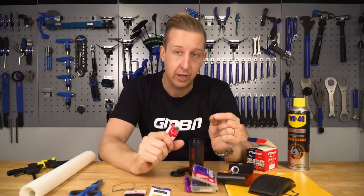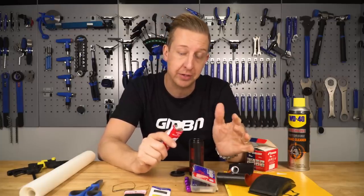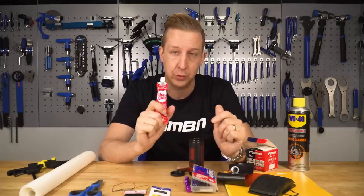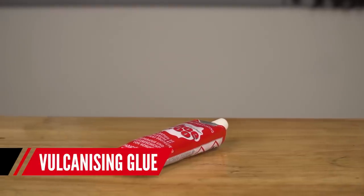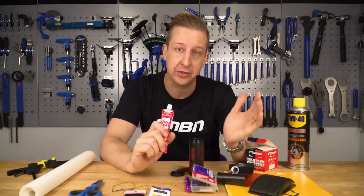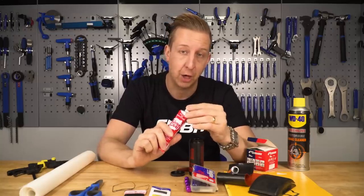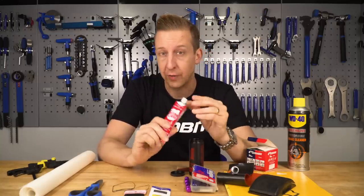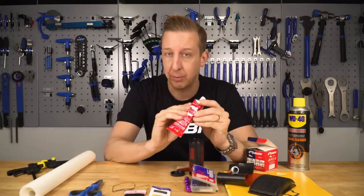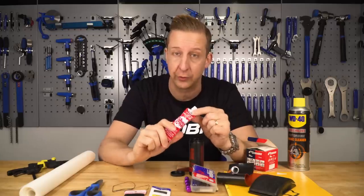The last thing you're going to need is something to finish the job on the outside. The idea is to stitch up the hole, patch it on the inside, but because the stitches are still exposed on the outside you want to give them some protection. This stuff is called Shoe Goo - if you've ever been into skateboarding you'll be familiar with it. It's the stuff you'd smear on your ollie foot to protect your shoe against scuffing, and it can also repair the soles of shoes. It puts a very rubbery, flexible coat on top, making it ideal for protecting the outside of the tyre afterwards.